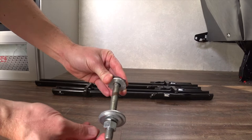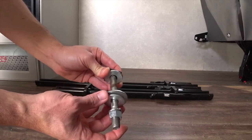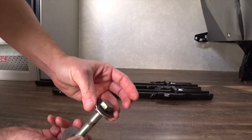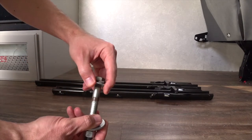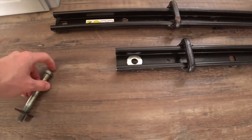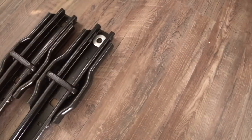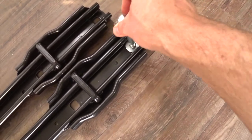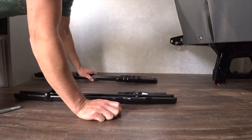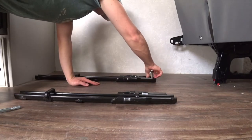Here's the hardware setup I'm going to use: a four-and-a-half to five-inch bolt, one nut, a lock washer, and two flat washers on the bottom to give a lot of surface area, plus a circular flat washer and a square washer on top that goes through the rails. I'll slide the washer in and slide the bolt down. At the front I'll do the same — slide the washer in and get the bolt through — then do the same with the other rail at the front. Then I'll go down below, put on the nuts, the flat washers, and the lock nuts.